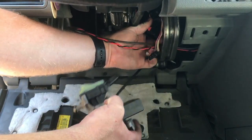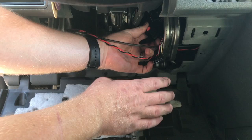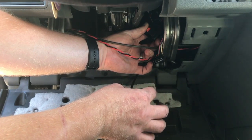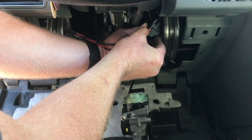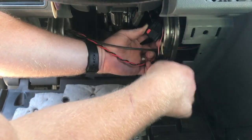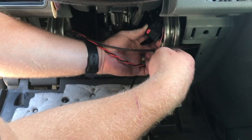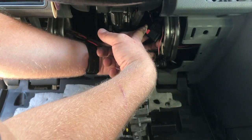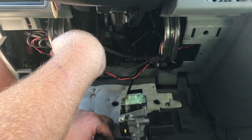On the wire that goes in the back of this, this is the actual recall, so this is the one that was replaced from the factory before, so this is the upgraded one, and you'll have this red clip that will hold it in to keep it from popping off and on. So if you're gonna try to pull this off without pulling it out yet, you just gotta unclip this, and then it's just the normal clip where you push it down and it comes out.